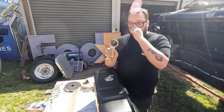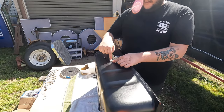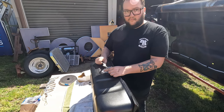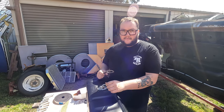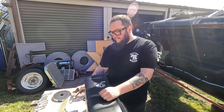You can get them with a multi-fit. Andrew lent me this one. Essentially what it does is it goes over the top and then the tangs of the sender go in there so you can turn it and tighten it without bending the prongs over. If you try and hammer them it always messes them up and doesn't do a very good job. Webby's recommendation, Andrew's tool — so thanks to both of you.